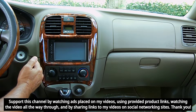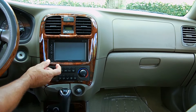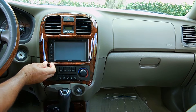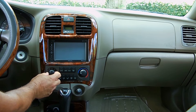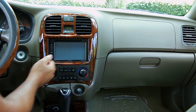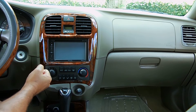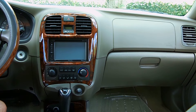Sometimes the door that opens and closes for the heater core does not close fully — it may be open partially even when the switch is set to cold. As a result, when the AC is off and you put the fan on, you're going to notice the air is very warm coming out of the vents because that door is not tightly sealed. If the AC is on, you're going to notice the air is not as cold.